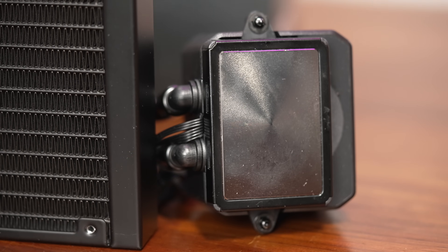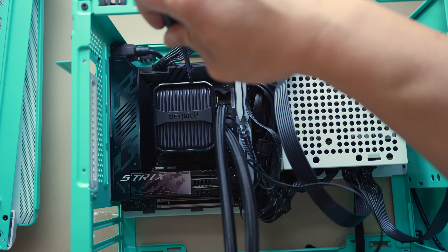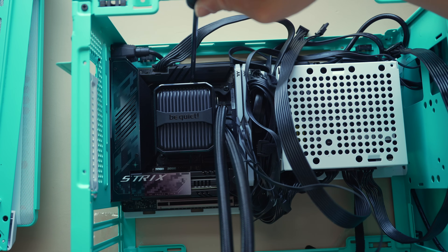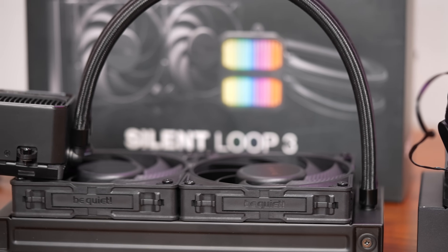The mounting screws are not centered about the frame, but they are centered around the cold plate, so there's a little bit of overhang on the non-elbow side. For today's test I mounted up with ASUS's Z890 ITX board and the Intel 285K, and it fit within all the heatsinks without complaints but also without any wiggle room — a razor-thin margin. The block height is about 55mm. I did notice that when I disassembled the unit the standoff screws had lost their pre-glued insulation washers, so be careful if you ever swap to a new build that you take those off the board.